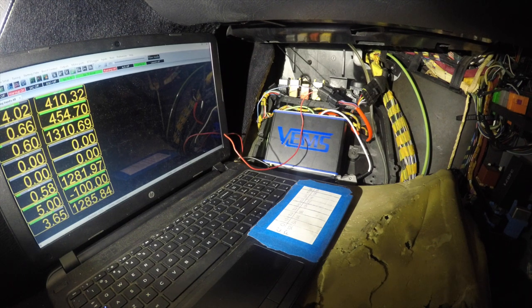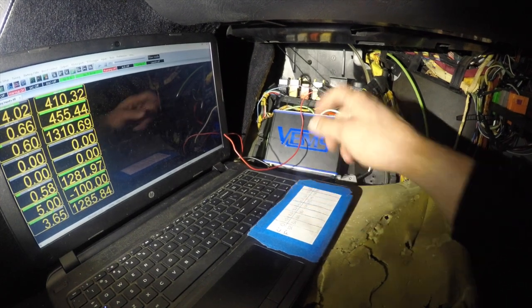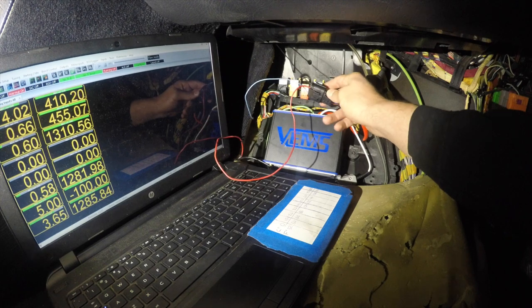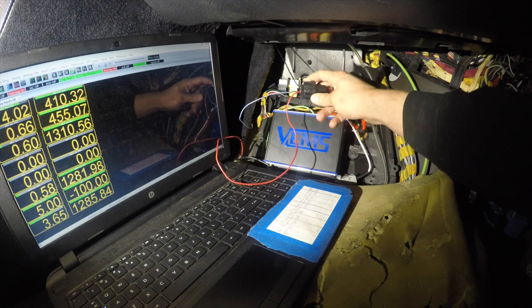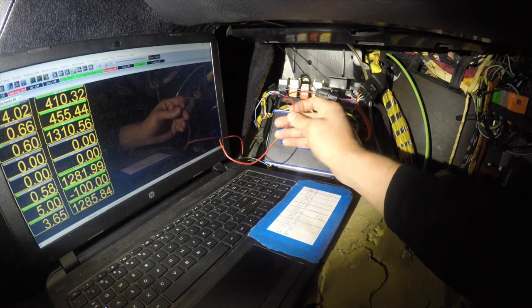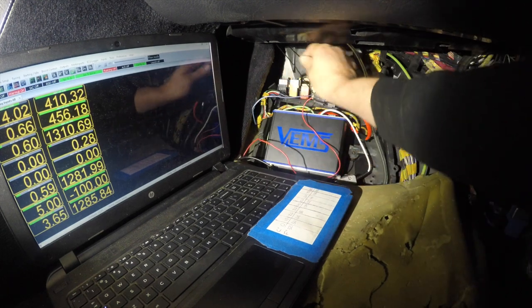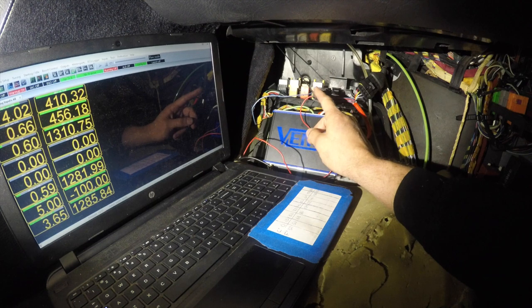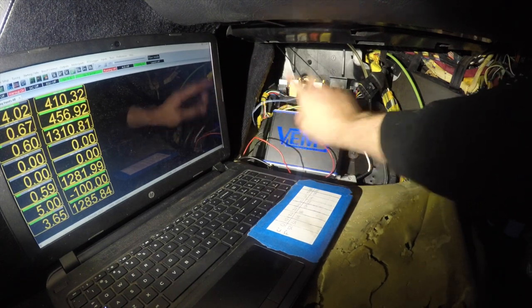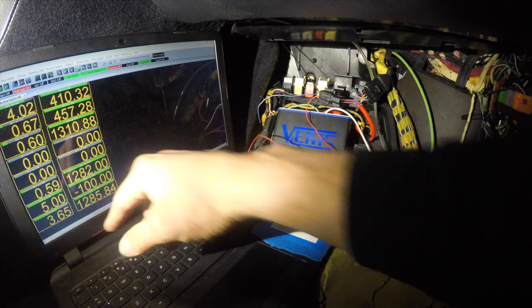For now, we need to get our channel for the launch control. We've got the ECU, the wires coming out — you got the O2 and then you got your auxiliary. This is basically the auxiliary input; anything you need to add is going to be here. I've got my second fuel pump for high boost, this one is the launch control, and this one's the shift cut. Each of these circuits needs to be grounded to activate. That's how you find the channel.